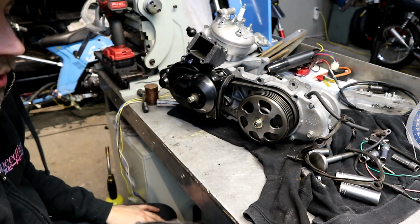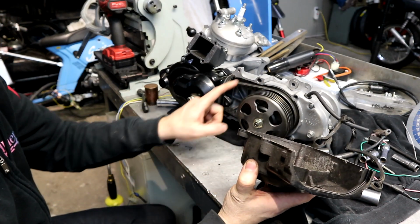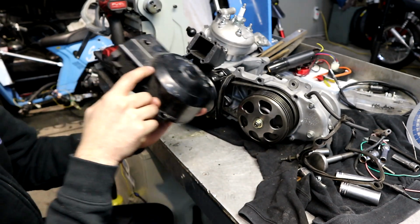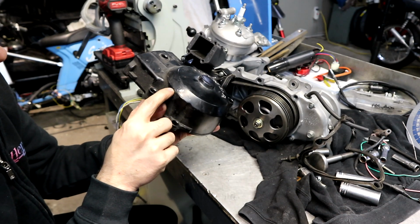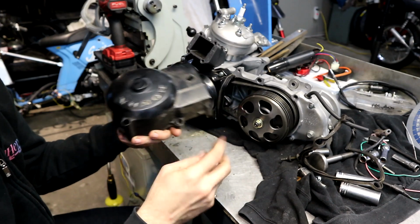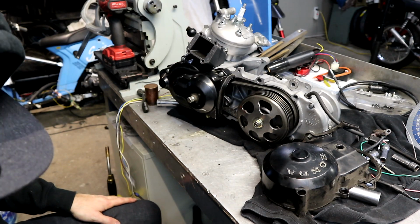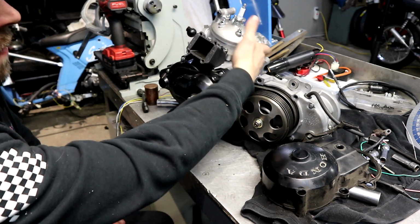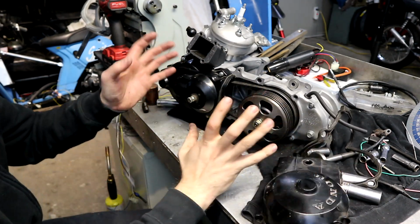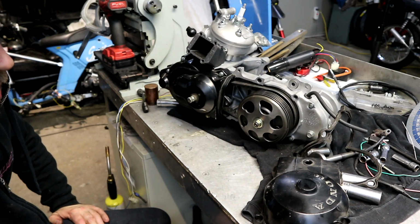So I like running the rear half of the case on there, but obviously you can't do it with this large bell, not stock. However, if you mill this case down to that line the whole way around, including taking some off this boss all the way around, it will fit on. I'll go show you on the other scoot that I have. Take it off and show you what I've done to that. I've never seen one of these cases break here, but having this little bit of extra on here probably helps torsionally to keep everything rigid. Whether it helps or not, I don't know.